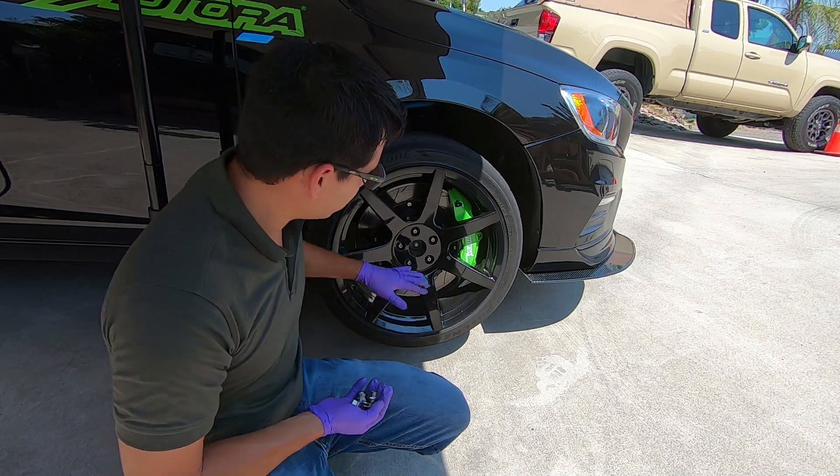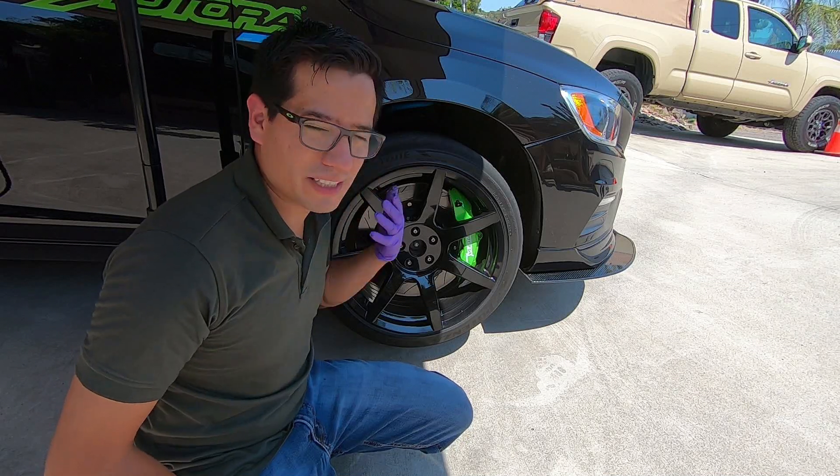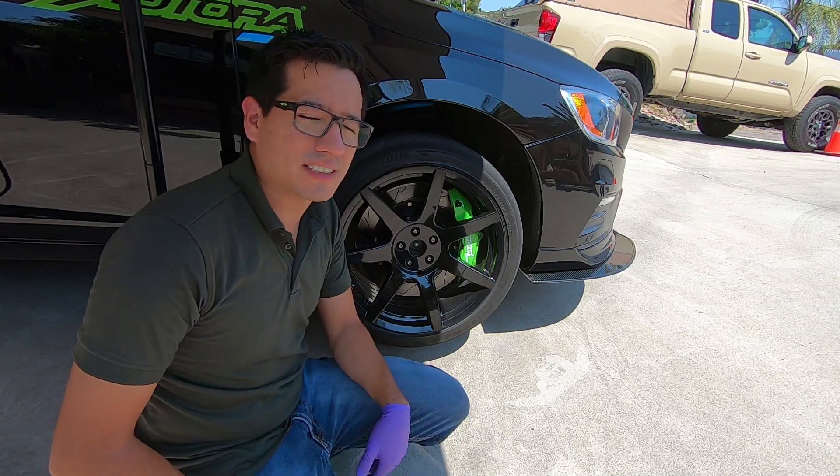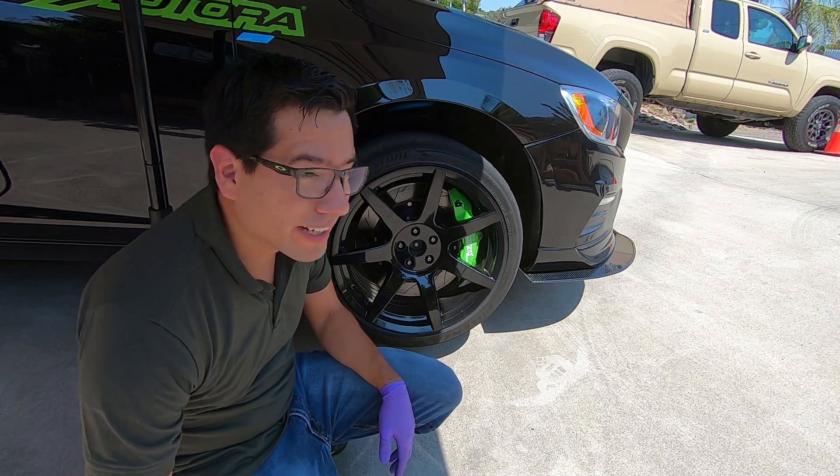Always make sure when you have the vehicle elevated to have it on jack stands as well. I also leave the hydraulic jack there as just another supportive device. Wheels are chocked because you need the e-brake off.